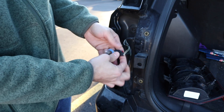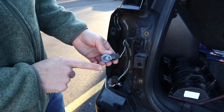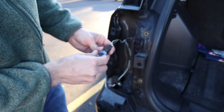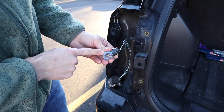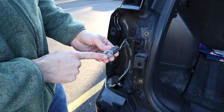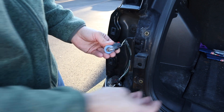This is the rear reverse light. If your bulb is the only thing that's broken, what you do is basically just pull this out and put in the new bulb, and very carefully slide it into place here and it'll snap into place. If that works, basically all you have to do is just go back in your car, put it into reverse, and make sure that this light illuminates. And then if that's working functionally and appropriately, you don't have to do anything at this point.